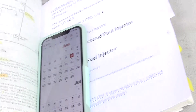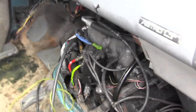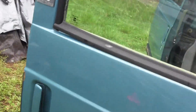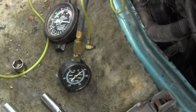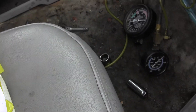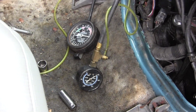Anyway, I've done what's in the A6 chart, and it's totally useless information. What I did was — it says pressurize the system, and I did that using the jumper from the test bung here, and checked the pressure. I can't do all this and run the camera too, so you're going to have to trust me. It came up to 55 PSI, and then it says block the supply line and turn off the power, and it should hold. Well, it didn't — it went back to zero rather quickly.